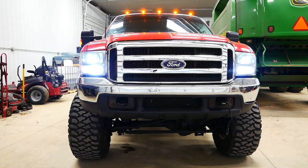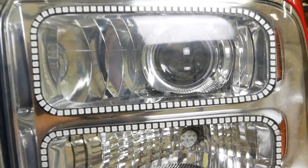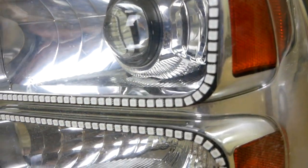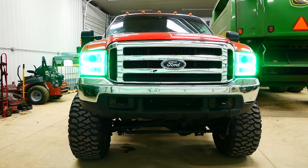The headlights are fully custom. I did the 05 to 07 conversion, cutting out the header panel, and when I had these headlights out I baked them apart and installed high-low projectors with a 5000 Kelvin HID kit. While I had the headlights apart, I also added angel eyes, which I like to leave on the amber setting because I'm using the switchback LEDs in the running lights — those are white most of the time — and then we have an amber outline around the headlight section and running light section as well. It's a cool look, but it's really just for fun.